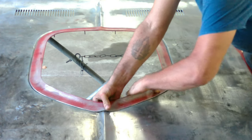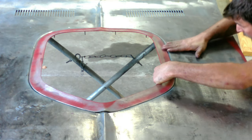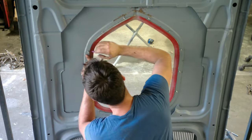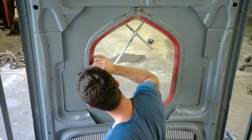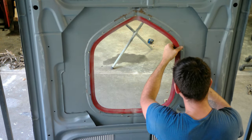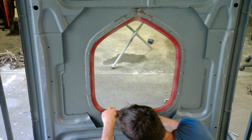Here's a big moment — the first time we're going to fit the shaker trim ring onto the hood itself before we do the under-bracing, just to make sure everything fits right. Really all in all with no trimming on this ring, nothing else — it fits really well. You can see the top front center is a little bit off; I really just think that's in the trim ring. All the measurements are on. We'll go ahead and address that later. Remember, this is aluminum. Now we're looking at the bottom — finding what's holding the shaker trim ring from setting down all the way, marking those areas, and we'll get them with the flap disc to finish off the top of this trim ring and get it really tight and looking good. Almost like factory.